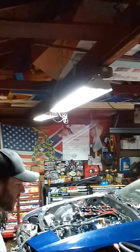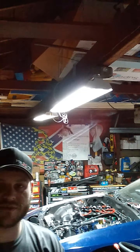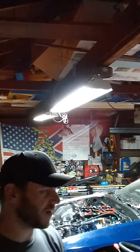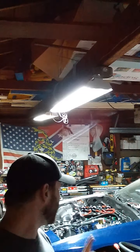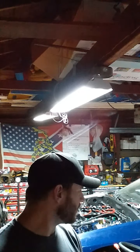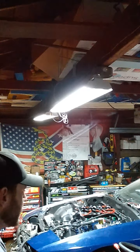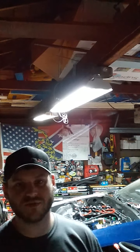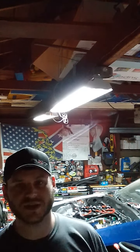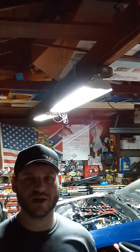So anyways, I got the rest of the things I wanted to heat tape covered up: the fuel lines from the fuel filter/regulator down to basically past the collector for the header. That turned out nice. I even covered the filter in that gold film stuff, and then finished putting the gold tape on the starter and the solenoid and all that good stuff. So I think all the heat sensitive things underneath the car are taken care of for now.